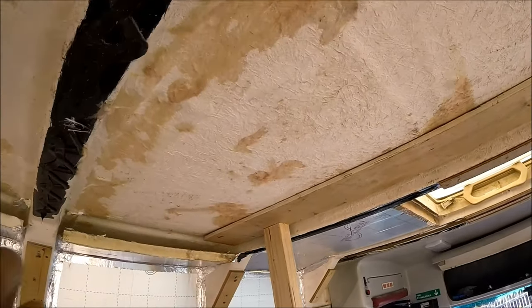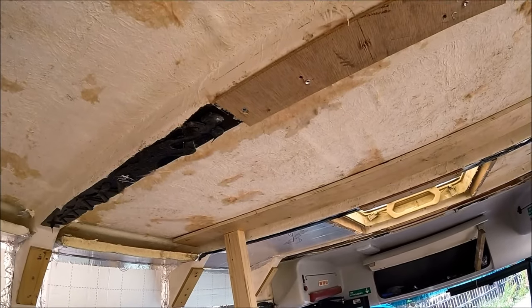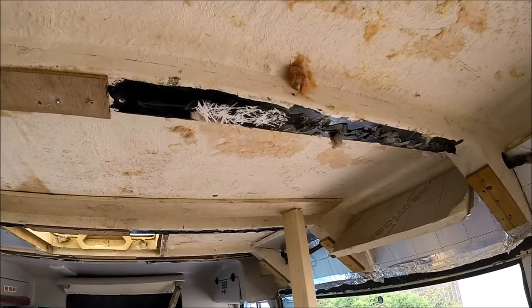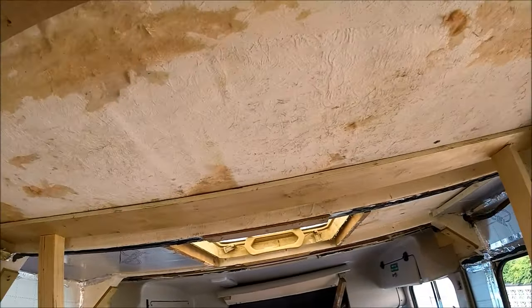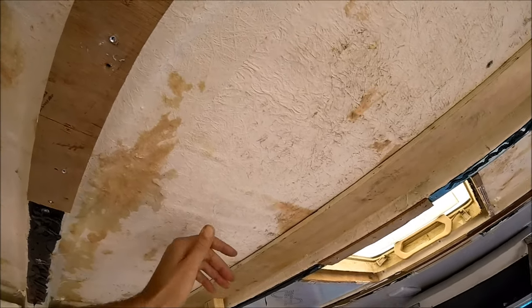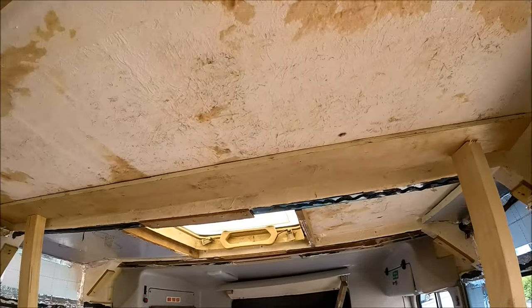at the fiberglass, just because fiberglass isn't as strong as steel in regards to slightly chipping away things like that. So it's always going to be best, if you're mounting panels to fiberglass roofs, to try and get them braced on the underside, just to take a lot of the stress and strain away from the fiberglass itself, because as you can see, there's a little bit of flex in it. So the more bracing and support you can give the actual bolts coming through, the better, really.